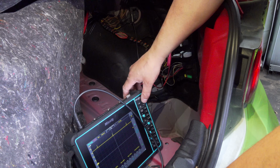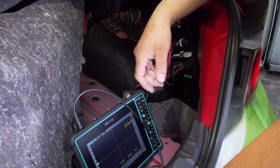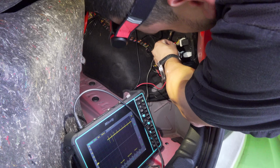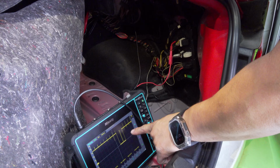Right, so we got something going on there. It ain't a whole lot, but it's very repetitive, and what I get from that is hello, hello, hello, anybody there? Nobody's answering. That's what I think is happening here. We're gonna go on the other side, because I know that KCAN is not supposed to look like that.